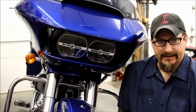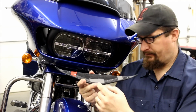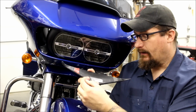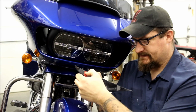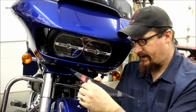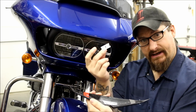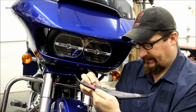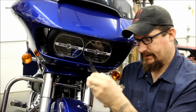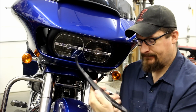Once it's completely clean, we're going to stick it on, and I'll show you a little trick here on how to get it lined up. Now on this tape, I pulled the backing off of 2 of them, but on all of them you want to take your fingernail and push down on this backing. What that does is it kind of activates the glue, makes it stick better, and then peel the backing off. If you can't get the backing with your fingernail, a little trick, you just use a razor blade or something sharp, just get it under there and flick it up. It will help get it started. Makes it a lot easier than trying to get in there if you've got your fingernails trimmed way down.